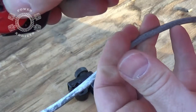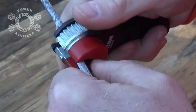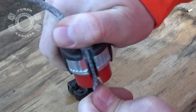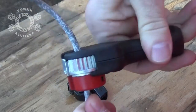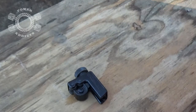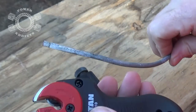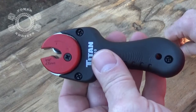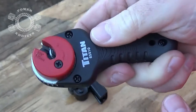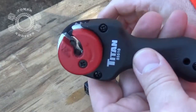With the quick-snap cutter, you see the little groove right there — get inside, snap it in, and you'll feel a pop. Then you start turning it like that. Easy! These are so much quicker, especially when you get into really tight areas because once you get it locked in you can just ratchet it back and forth like a socket and ratchet. Much easier in tight places. These are more universal for bigger fuel lines, but you can also buy these for other size lines.